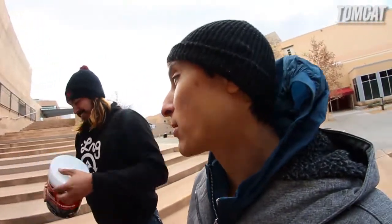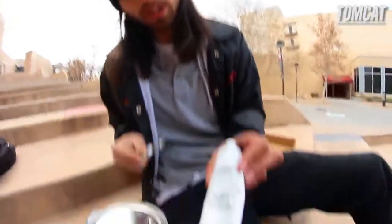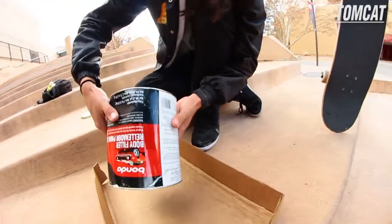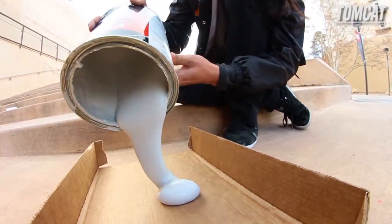We need you, Jordan — first tries! Just man arms. This here is the hardener. This is the bondo. This is going to make it dry. The more of this you put in there, the faster it's going to dry. It's all cold so it's taking a while. It's cold out so it's taking longer than normal. But you're going to need a lot more of this than you think. A lot of the times I think I have enough and then it ends up not being enough and I have to do a second layer.